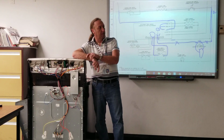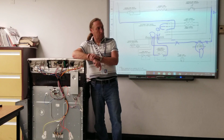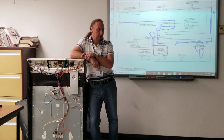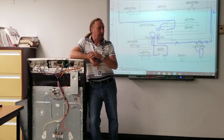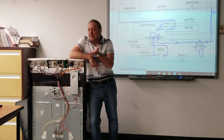Yes, Ricky? I had a situation where it wasn't locking. The hook that hooks into the door was bent. I replaced it because it was worn out over a period of time, so it wasn't the motor. It couldn't turn because the piece was bent down against the metal, and it wasn't allowing that lock mechanism to move. So I replaced the part. That was basically a simple problem.